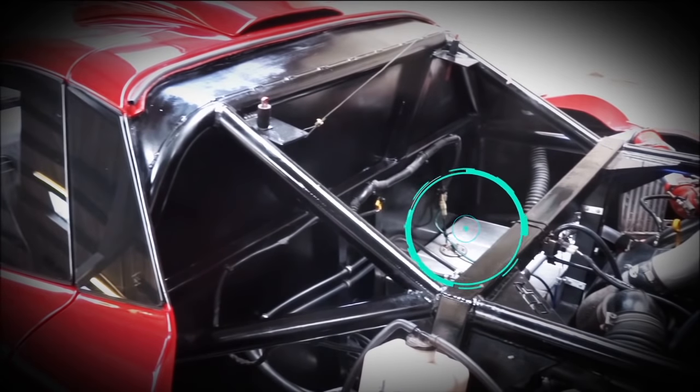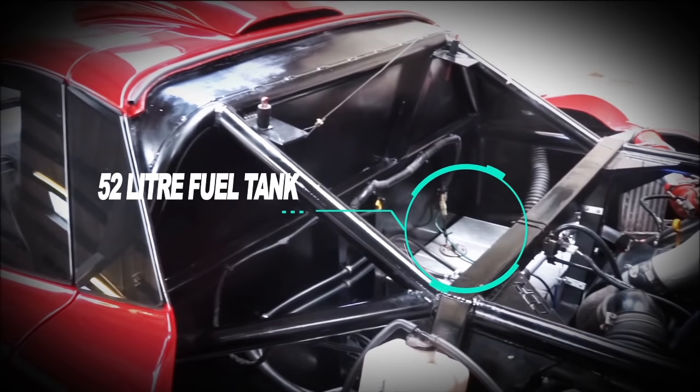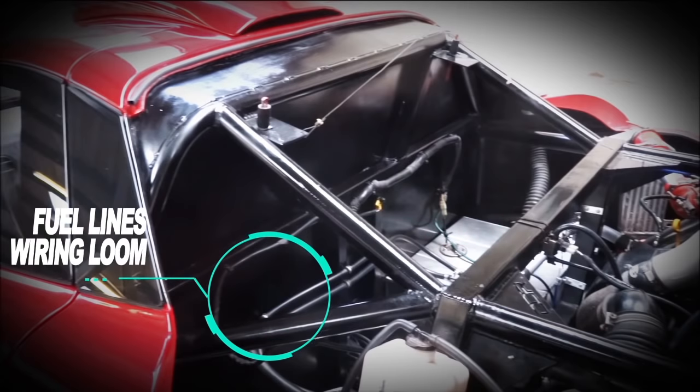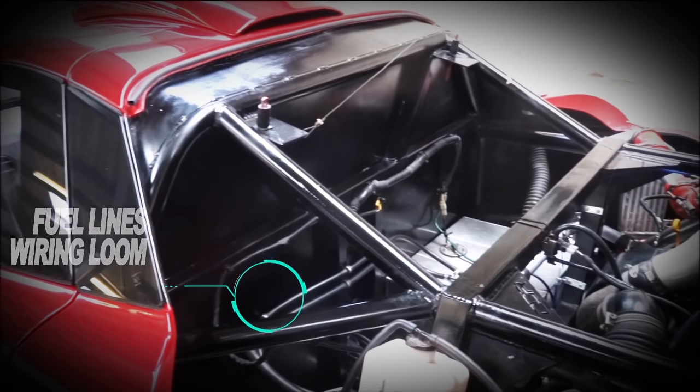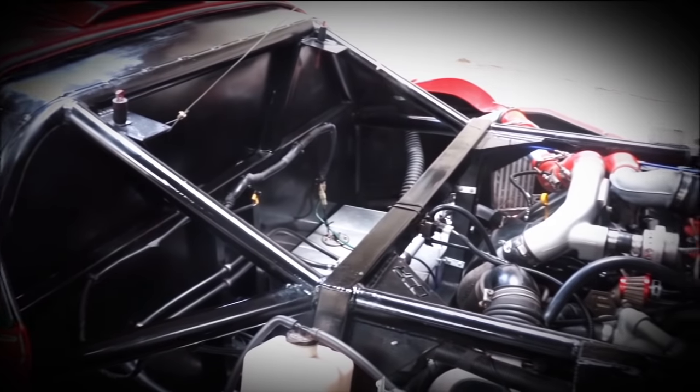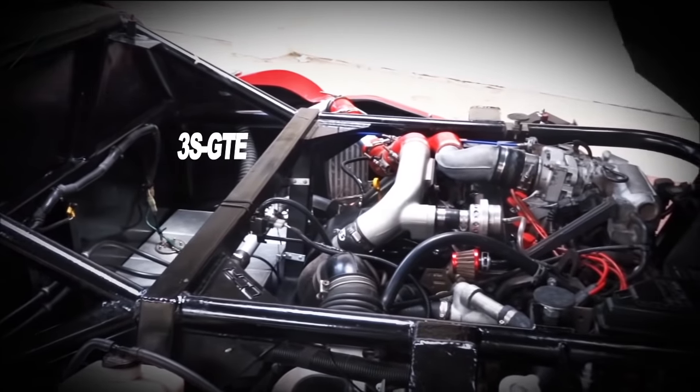At the heart of the car we've got the fuel tank — it's 52 litres, quite a square design, so there are multiple baffles inside to help the fuel stay at the fuel pump, and they're doing a good job. It gives a normal mileage range of about 250 miles. To pass the UK IVA test, all the wiring and fuel lines are highly secured around the car — it has to be neat and secure, and honestly it looks nice like that too.